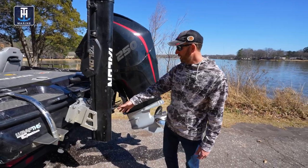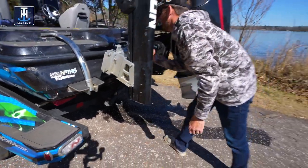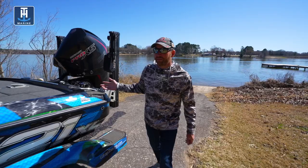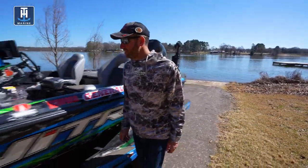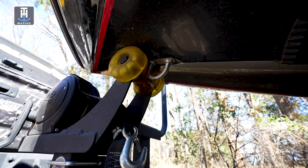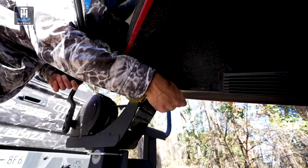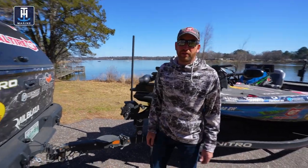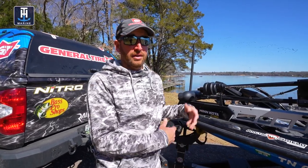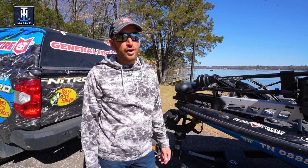Make sure you've got some type of good motor support. The final thing is to put this other strap on this side — pull it up, a couple of clicks, make sure it's good and tight. Plug is out. We're done back here at the back in about 90 seconds. Now's also the time to make sure to hook the front winch up if you didn't do it pulling out of the water. On our Nitros, we actually have a secondary safety strap — always a good idea to put that on; if it's there, you might as well use it. That's it — that's the way I trailer tens of thousands of miles every single year. Add my Dalco cover and I'm ready to go down the road for a long day in the truck.